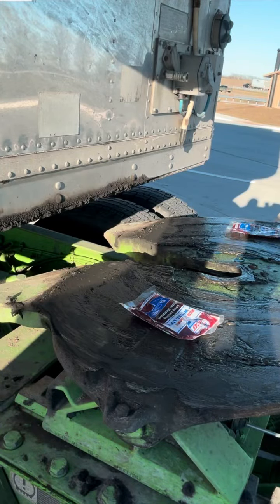The other brand slick packs work really good too — they're a black moly grease — but I really prefer the Lucas Red and Tacky version. We're going to back underneath the trailer with our air dumped and check to make sure we didn't peel them off the fifth wheel, because that would be bad and totally defeat the purpose. Did you see that? That way you're not just peeling that grease right off.